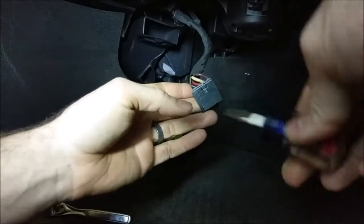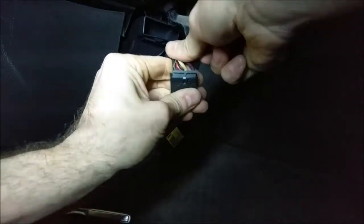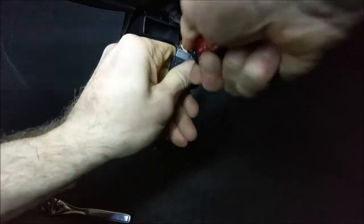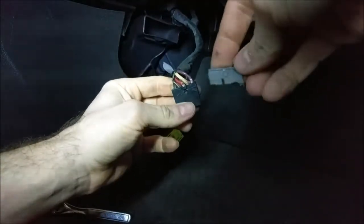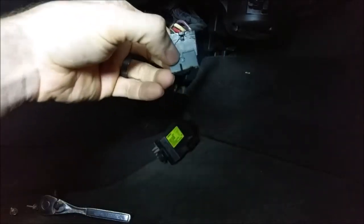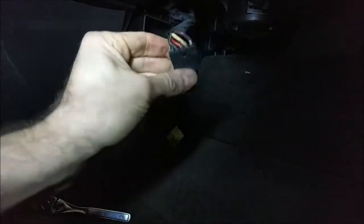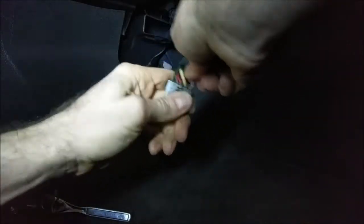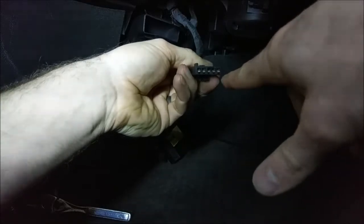First thing we're going to do — take that screwdriver you never thought you would ever use — to get the assembly lock out. Usually it's just a little burned plastic on the tips. Doesn't get hot enough to start your vehicle on fire, which is unfortunate, because if your vehicle would start on fire and this was a hazard, the dealership would be the one that has to fix this and not you. So let's see what else we've got going on in here — can we get some wires out? They are locked in even without the TPA, so that is a secondary lock. Typically if you look on the bottom there's an opening in the cavities. You stick a little pin or paper clip in the bottom and it should release it.